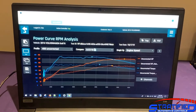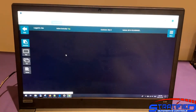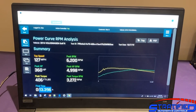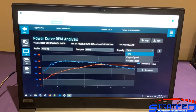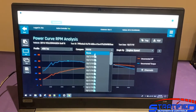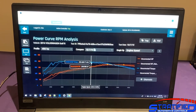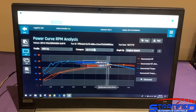Next we did stress testing in fifth gear, where a lot more heat builds up. The fifth gear pull took 13 seconds to complete — significantly longer. With more load on the vehicle, the engine generates more boost and more exhaust energy. Peak torque jumped to just over 400 ft-lbs. Compared to the fourth gear pull, spool comes in earlier in fifth gear, just as predicted, because the engine is loaded more and generating more exhaust energy.